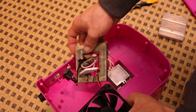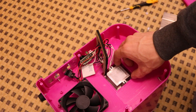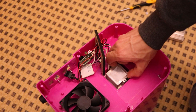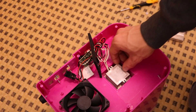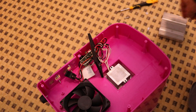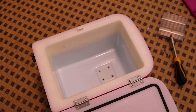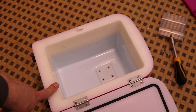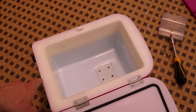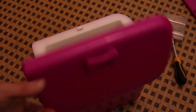There's some foam isolation. Over here we have a cooling block but that seems to be screwed down from the other side — yeah, this thing is screwed down from here as well, so I will remove these screws as well. Alright, I removed these screws. The inside actually looks very well; I had this from the garbage and it looks pretty fine.